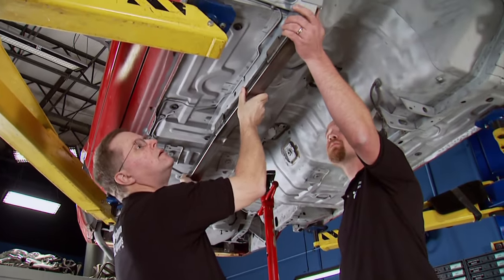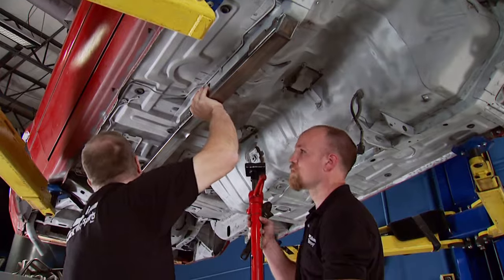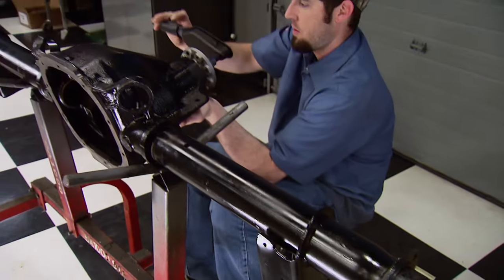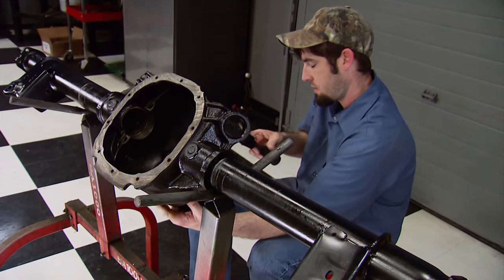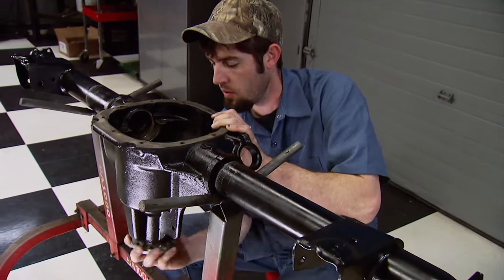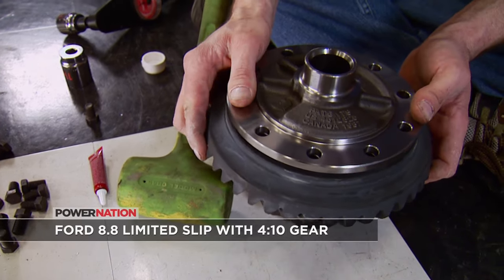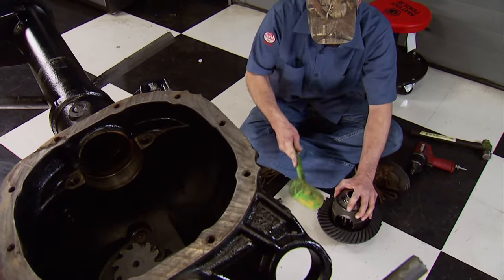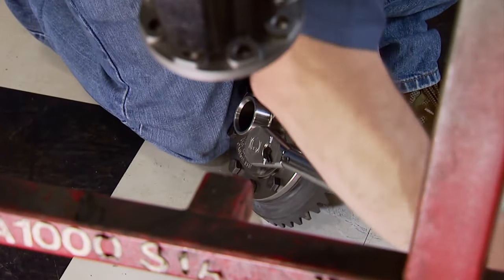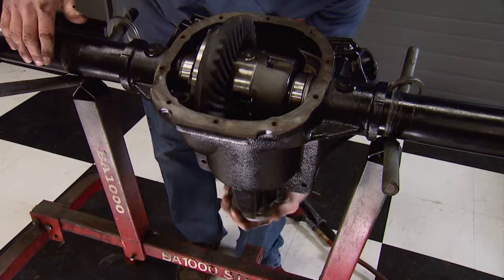Our kit came with Jack and Luca, who helped design and market this heavy-duty G-Force tamer. While they test fit their full-length subframe connectors, I'm getting the rear axle together. A set of heat-treated 4.10 Richmond gears are being installed — the pinion gear is already in and I'm checking the bearing preload. The ring gear attaches to the Auburn Gear Pro Series Limited Slip diff. After aligning the holes, I'll start fasteners with red Loctite. Using a soft dead blow, seat the ring gear and torque the bolts. This diff has a cone-clutch design for lightning-fast power transfer, ordered for 31-spline axles.